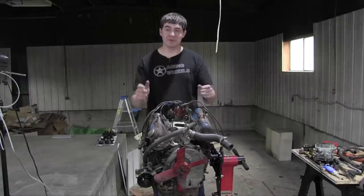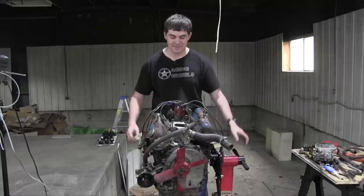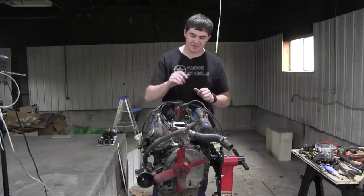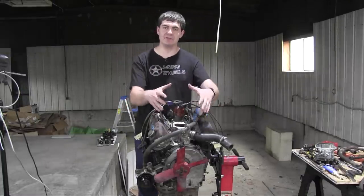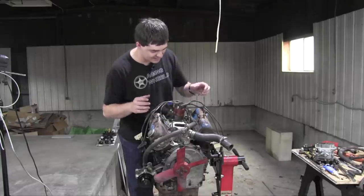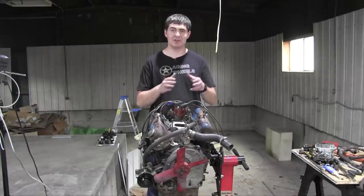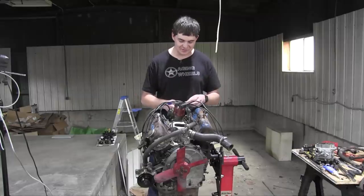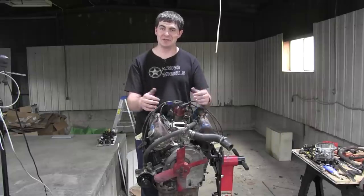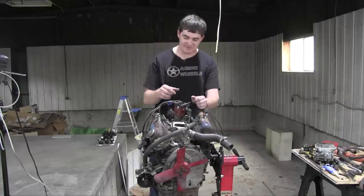All right, anyway, before I was so rudely interrupted by my very rude and inconsiderate voiceover, I was explaining that I've got most everything on the top of the engine, except for the carburetor, so that I can see what gets in the way of the new carburetor setup. I've got the thermostat housing up here, the distributor, some lines, this bizarre twisty throttle linkage. Because this is a Saab we're dealing with, there's not a simple throttle cable. There's a series of linkages and rotations and twisty rods that lead up to the accelerator on the carburetor. I got a question why they did that. Seems to be just because they wanted to. But that's how it is, and I have to make the new carburetor work with that.